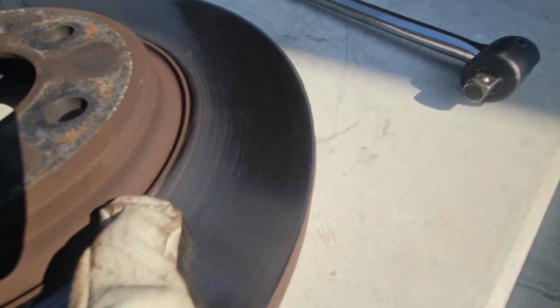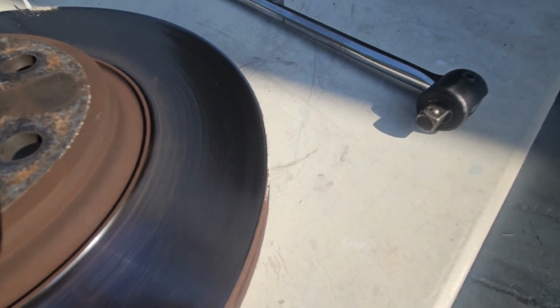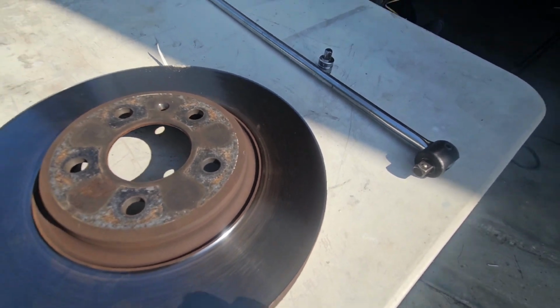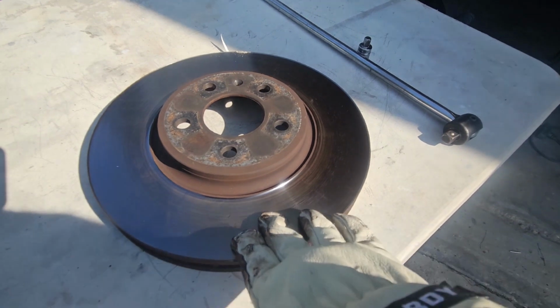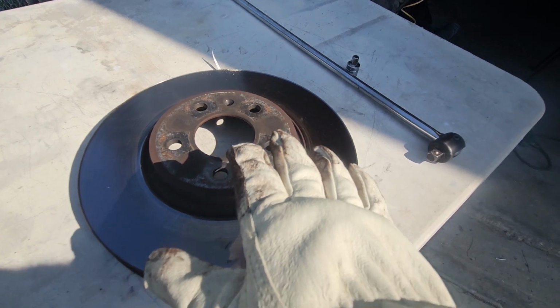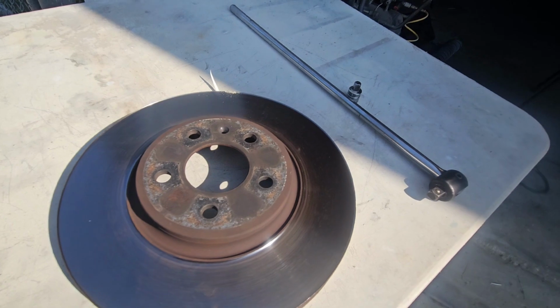And that ridge where it's worn in here and worn in here is why I had to pry the pads back to get the caliper off of the rotor. But more importantly, it's warped. There are areas that have become extremely heated to where it's become kind of wavy, so that when you apply the brakes, when you're slowing down from a decent speed, the whole steering wheel shakes.